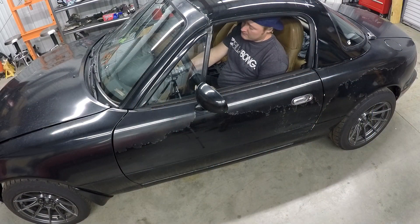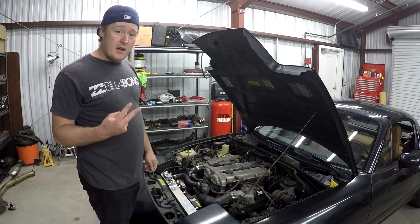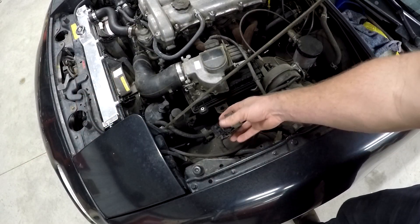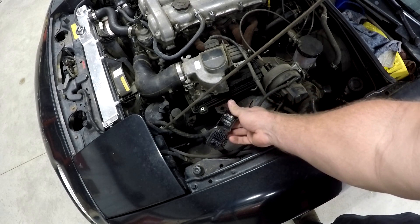Go ahead and start your car and pop the hood. There are two things you need to do while the car is running. Come over to the driver's side at the top of the fender and open up your diagnostics box. Normally on the driver's side of a Miata there's a bracket holding this up, but the previous owner apparently deleted it so the box is just sitting here. You're going to need to jump the connections in here. If you look inside, you can see a diagram in the back. You need to connect the 10 and the ground connection on the top half. Now the car is running in diagnostics mode and it should set a smooth, even idle.